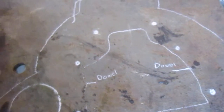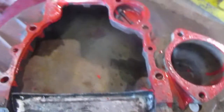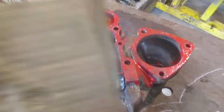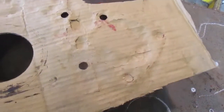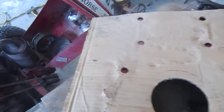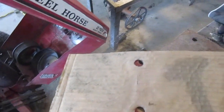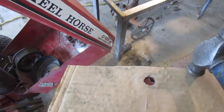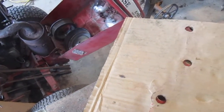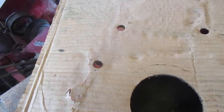My next process is to flip the bell housing over, paint it a bright color — I've chosen red — and do a transfer with a piece of cardboard. I've taken a piece of cardboard and used a hammer to tap around the edges to cut out my bell housing holes so they're reasonably accurate. It's the same process as you'd use to make an old gasket. Now I have a cardboard template outlined in paint and the holes are punched through with the hammer.